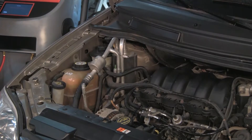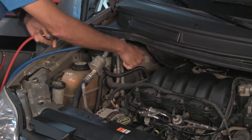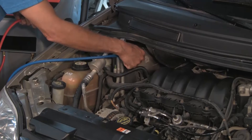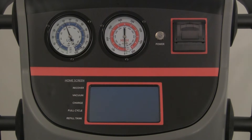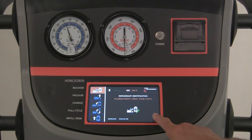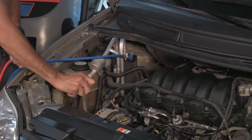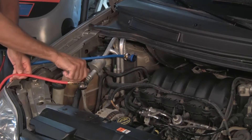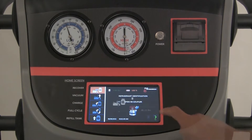This is liquid tank fill. Press the blue low side service hose to the low side R1234YF port on the vehicle and open the blue coupler valve. Press the green arrow. Once the refrigerant identification process completes and passes, press the green arrow. Connect the red service hose high side coupler to the high side port on the vehicle and open the valve.